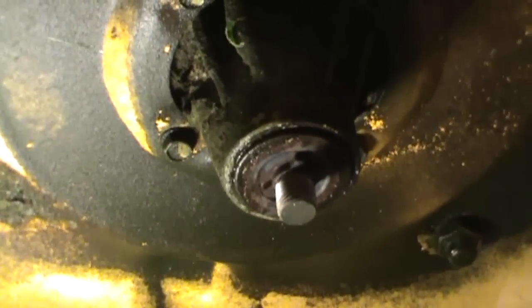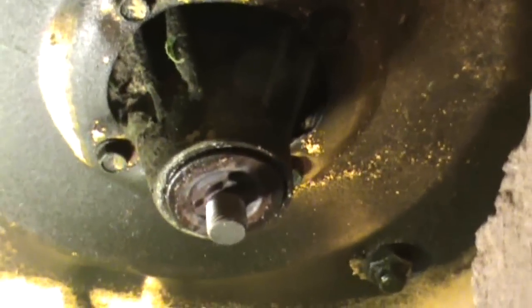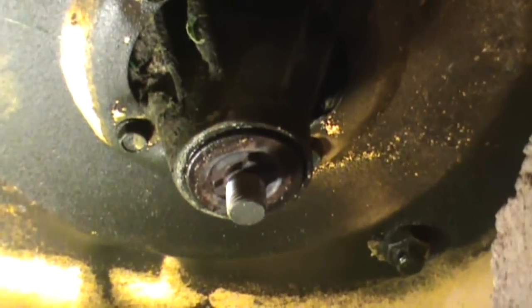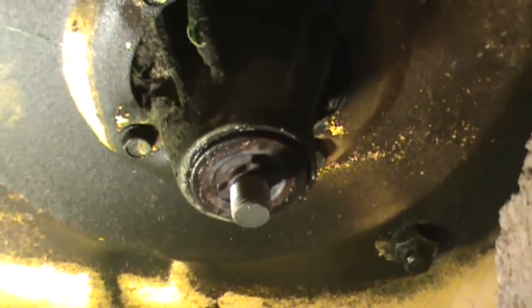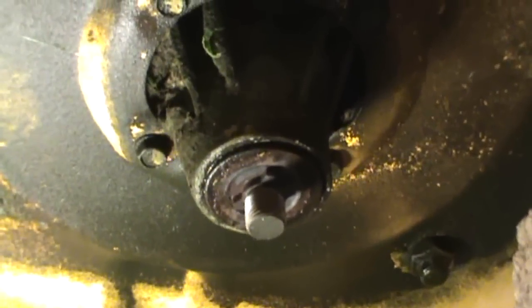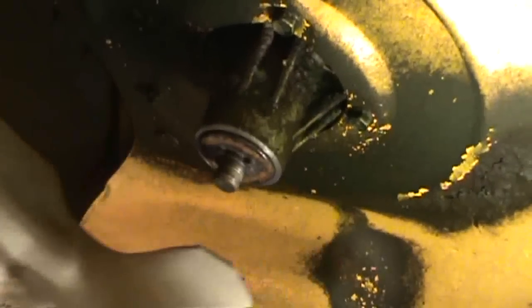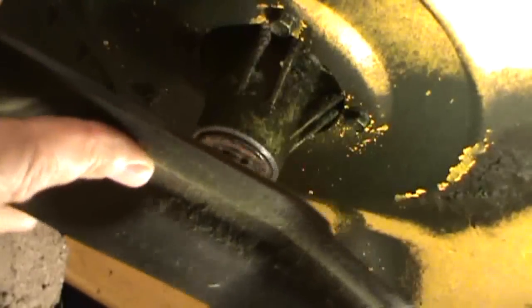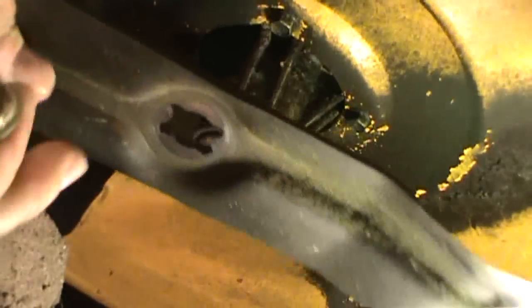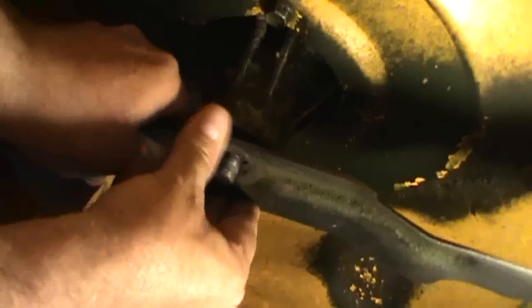Now there's a spindle. It's keyed basically so that you can really only get these on in one way, and they do have to be 180 degrees from each other, otherwise they would collide. Let me go ahead and get my impact wrench, zip these back on, and we'll be done. Okay, we do have to make sure we get this on right. The little ears need to be facing upwards as opposed to downwards, so they create some suction. There it is, right there, locked in.